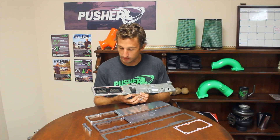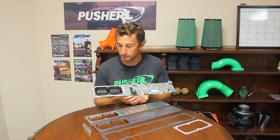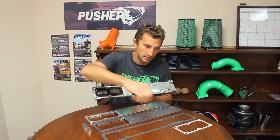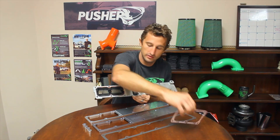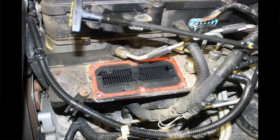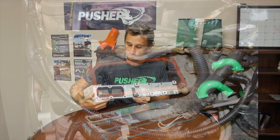The reason we say that is because this guy blocks a lot of airflow to the head. You can see here where the factory gasket used to be — I have one right here I can overlay for you. There's a lot of available area there for air to flow through that's blocked.